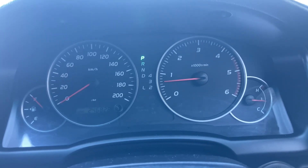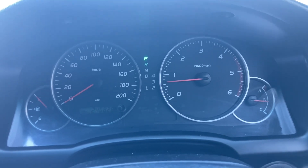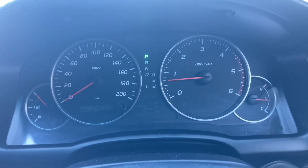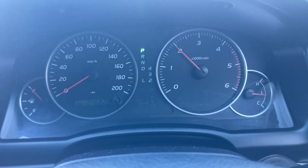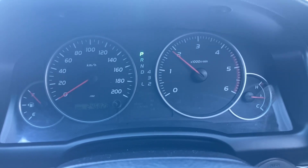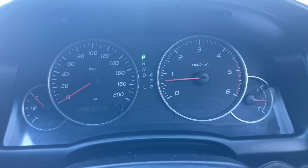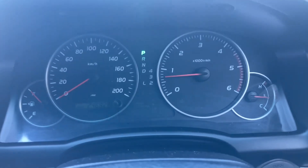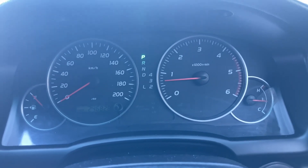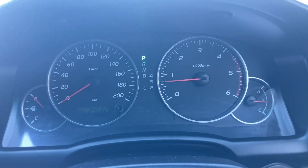Keep the RPMs nice. Depending on where you live and which way you're going to go when you get onto a main road, these are things you've got to consider. But don't just let it sit there idling, and don't just sit there warming it up stationary. Just get in the car and drive it - but drive it nice. Warm it up and it'll take you no more than five minutes.